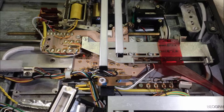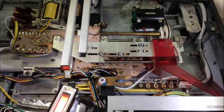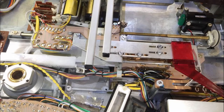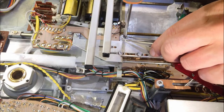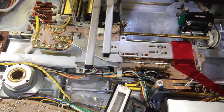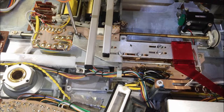It's convenient to move the carriage a little bit over so one can access the board better once this plate here has been removed. Now we can take out the spring carrier. One needs to be a little bit careful here with the position indicator, because it sticks into the keypad assembly. So we take out the two screws, and then we lift this plate out towards the back of the turntable.